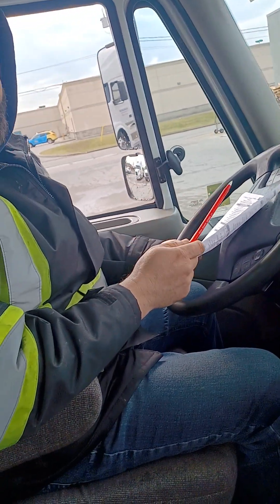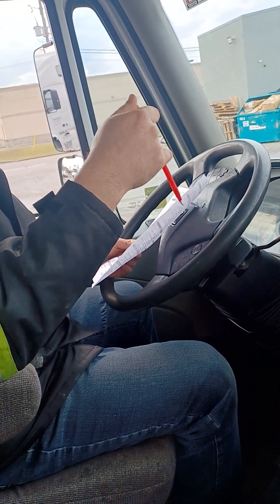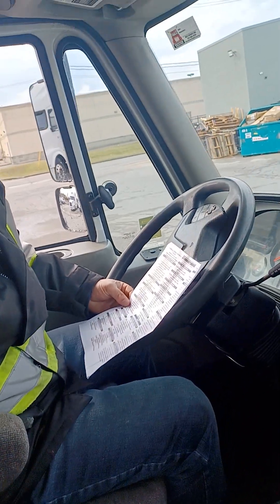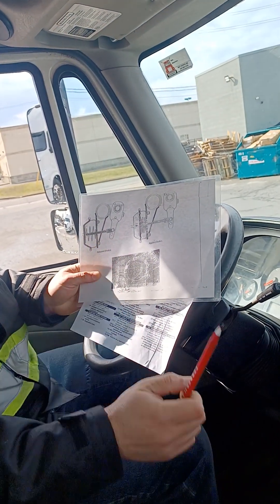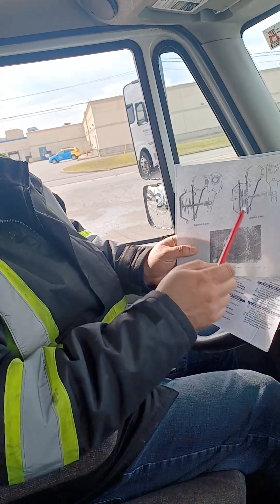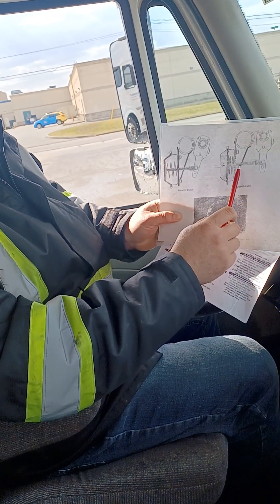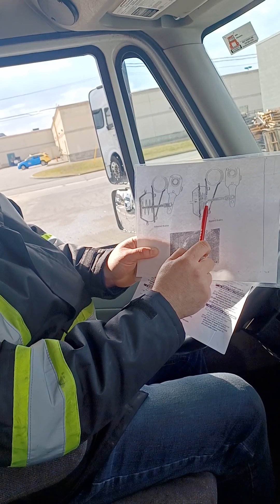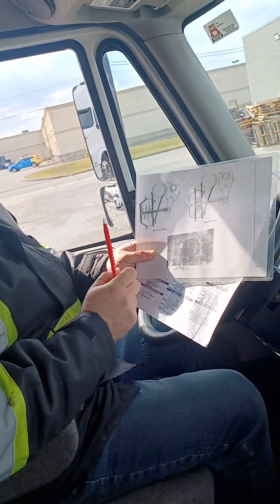If she brings out the picture instead of having you go beneath the trailer, this picture shows your brakes released — buttons are in. When your brake buddy is in and your brakes are applied — basically when you're pushing down on the brake — this push rod comes out of the brake chamber. You measure from your original mark to where it extended out. You measure from your mark to the brake chamber wall, and that distance is your adjustment limit on that brake.